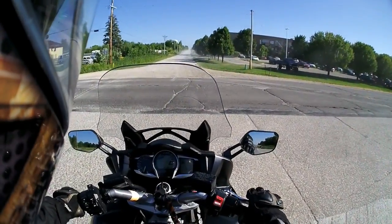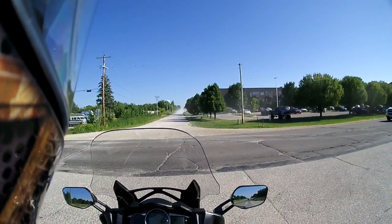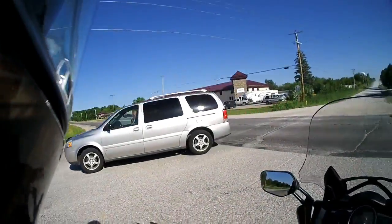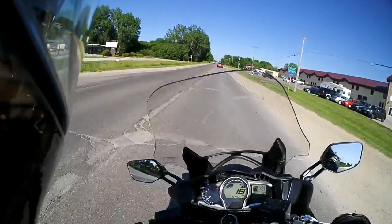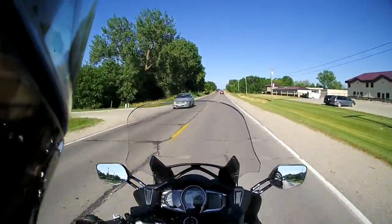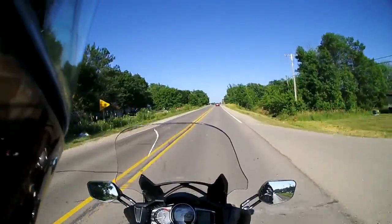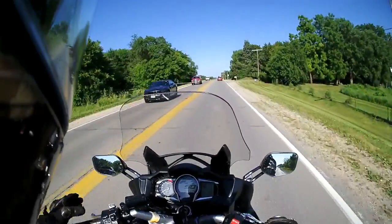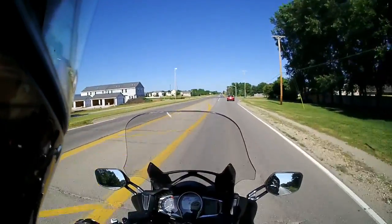So, what else can I say? Up-down windshield. I've got 2 trip meters and an odometer. Ambient temp, coolant temp. This bike typically, in the weather that I get here in Iowa, runs about 160, 180 when it's 70, 80 degrees. Those are all normal temps. 200 is a normal temp, honestly, if you're riding in Arizona and it's 110 degrees outside. But it doesn't run that hot typically for me, as long as I'm moving down the road. If I'm stopped in traffic on a hot day, near 100 degrees, then yeah, I get those temps, but it's still not overheating. That's acceptable.